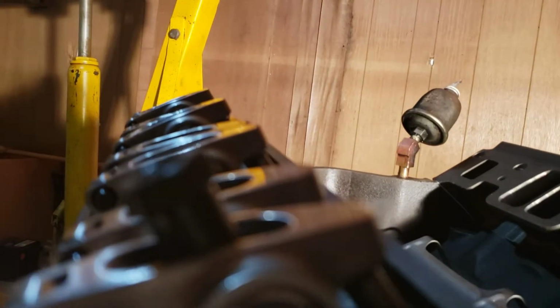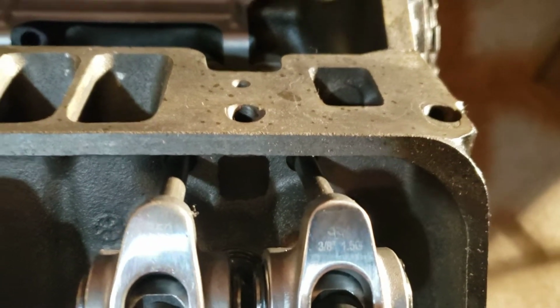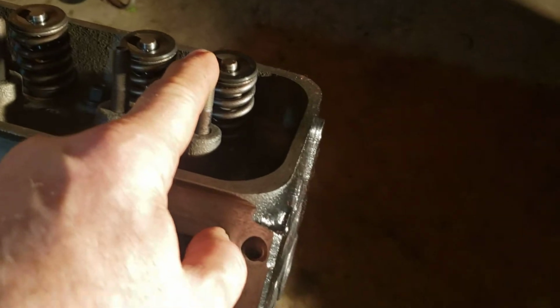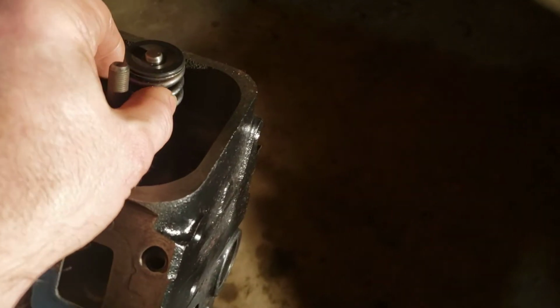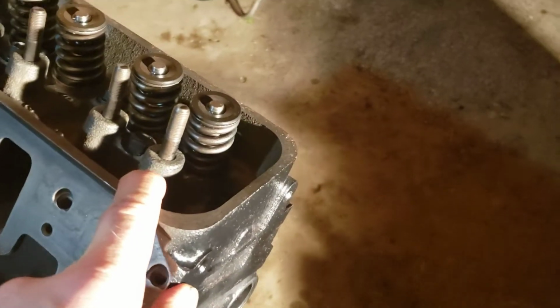It's a little harder with these self-centering roller tip rockers to eyeball it because you can't see the roller under here, but you gotta have this as the center line, and you can go off the center line. You have the center line of this where the roller is, and then you can go off the center line of the valve. Yeah, this is a half inch lift cam with the 1.5 to 1 rockers. What these are in their press-in studs. You don't want to go any more than half-inch lift without putting screw-in studs. These are like Z28 springs. I'm hoping that'll work and it won't pull out the press-in studs. It's either going to work or it ain't.